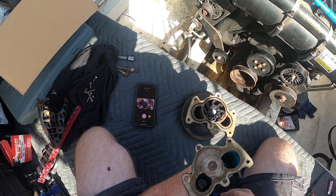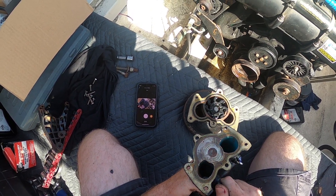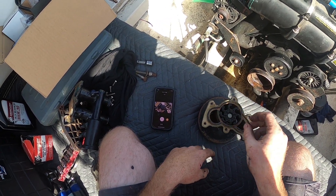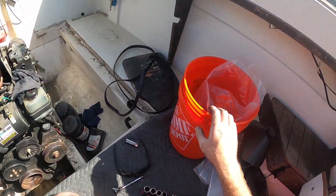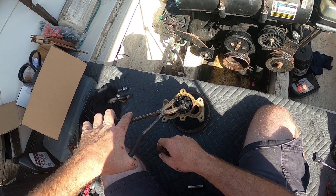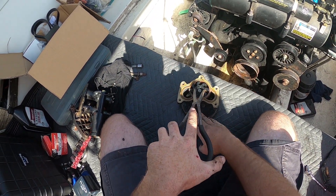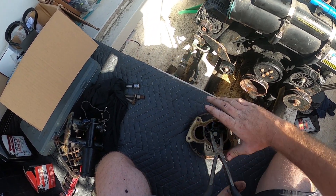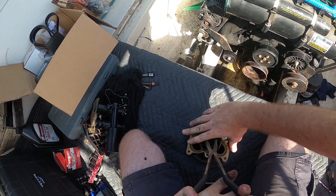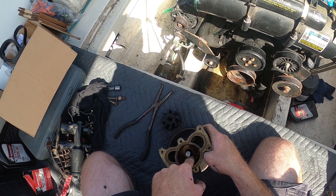Let's take a look at the housing and impeller. The housing is all brass. If you can feel a groove in here — which I can — you're going to have lower water pressure, usually two to three PSI lower at wide open throttle. Swirl marks like this indicate sand was in here at some point. Now we'll take the impeller out using impeller pullers — a special tool. Position on the two sides of the impeller, twist the housing with your hands, pull up, and the impeller comes right out.